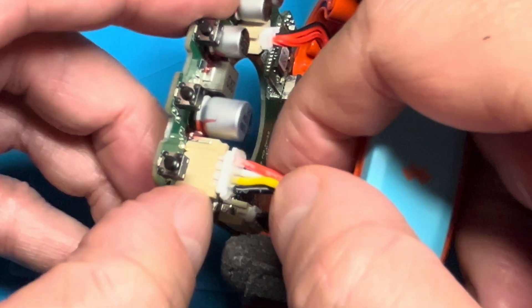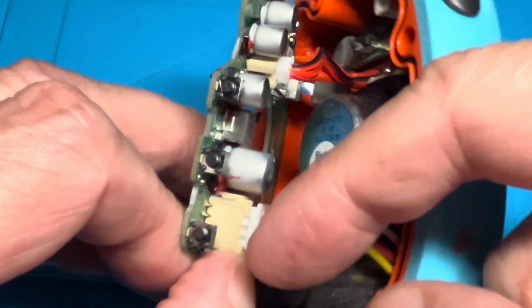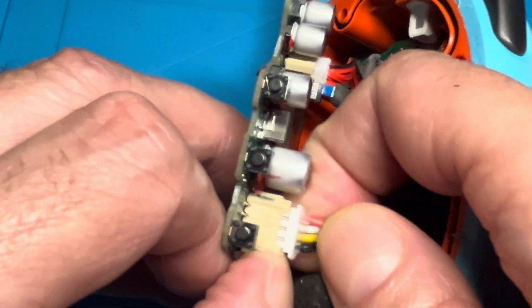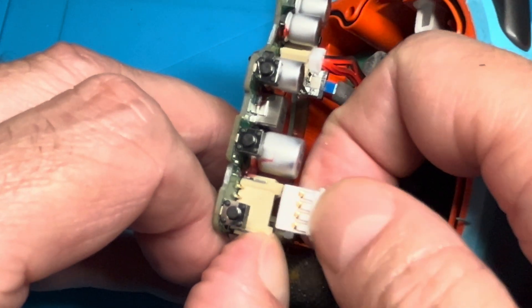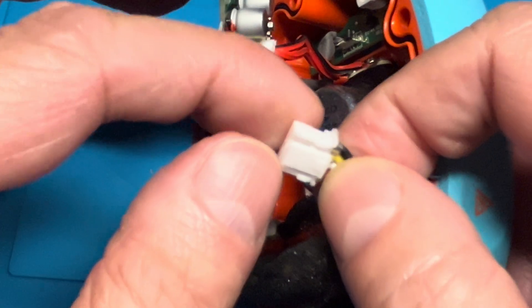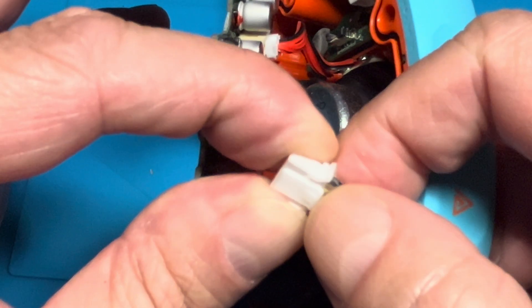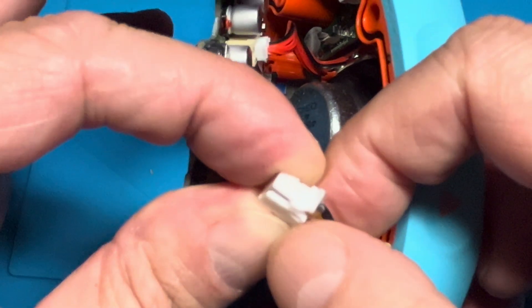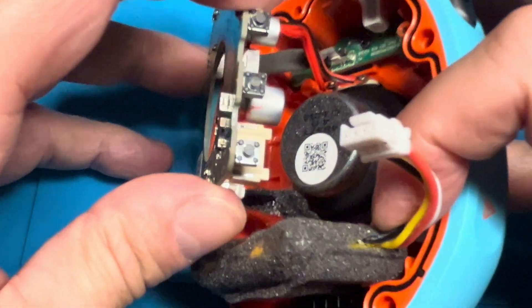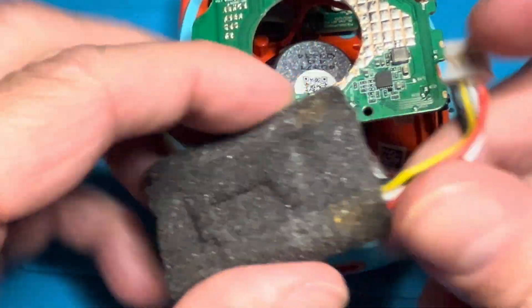Now on the bottom we can see the connector to the battery. Hold onto the darker part of the connector — the one soldered onto the PCB board. On the back side of the white connector there's a tiny lever. Push on that lever and then you can easily pull out the connector and the cord that goes to the battery. You can see how pushing on that lever releases the connector. That was pretty much it — now we can pull out the battery.